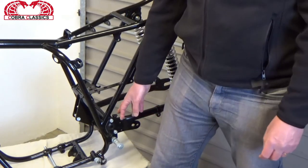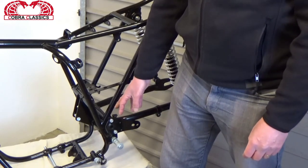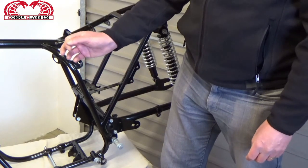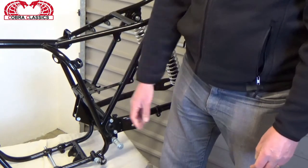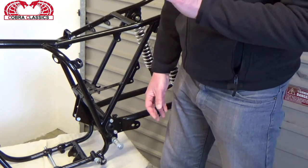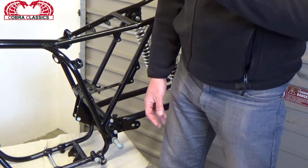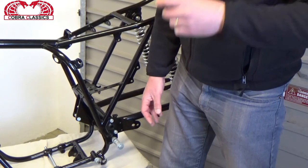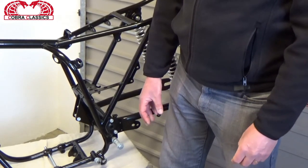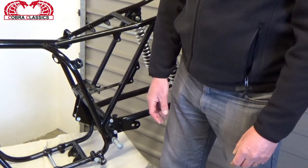To get them out, the best and probably the only way is to actually burn them out — to use a blowtorch and melt the internal rubber, then take out the internal metal bush. The other one is quite tight inside the swinging arm, so you need to finely cut it out at one edge and work it out from there. It is quite a difficult job, and when melting rubber, use some sort of mask or ensure plenty of ventilation, as it can be quite toxic.